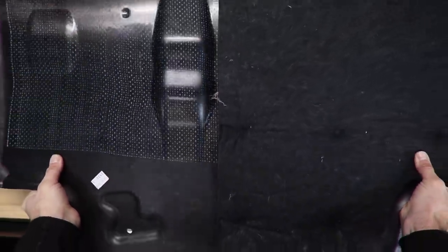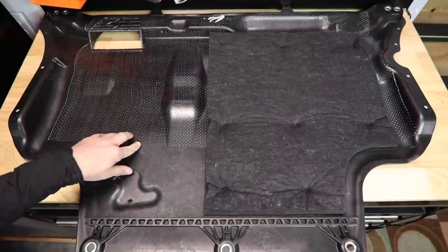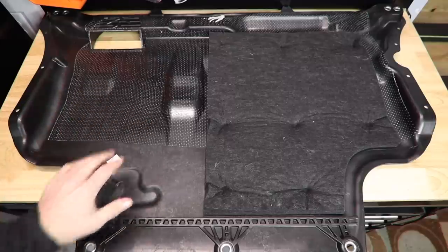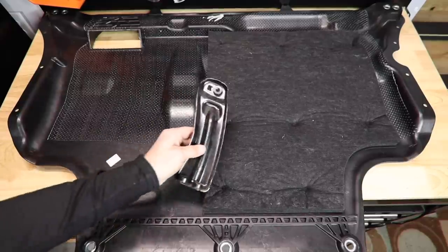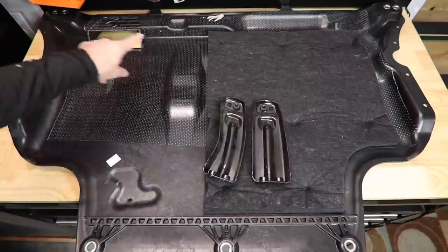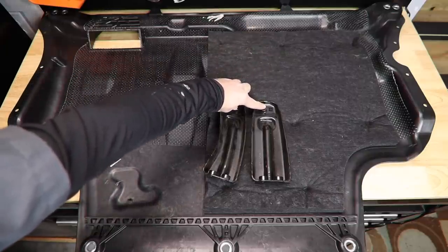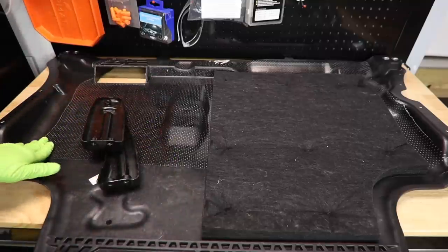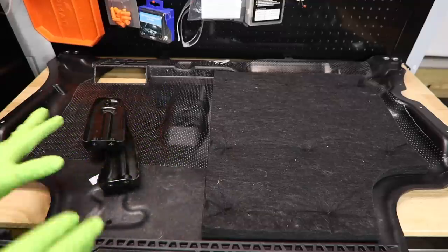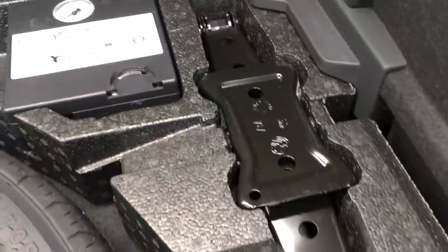And this is our Alltrack belly pan. As you can see, this guy is quite a bit beefier than the flimsy factory pan. In order to install it, we're going to need the pan of course. We can reuse the T25s we removed for this pan. We'll need two brackets for the mounting points at the front of the pan, and nine bolts total — two of those hold the brackets to the frame rail, and the rest hold the pan on. It's quite a bit bigger and reinforced. Big ups to Paul and the boys at Shop Dapp for putting this together — I'll link it in the video description.